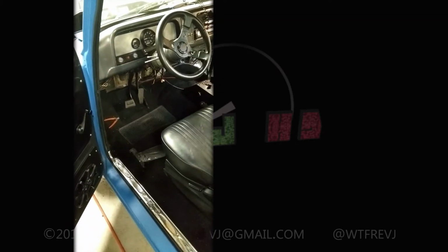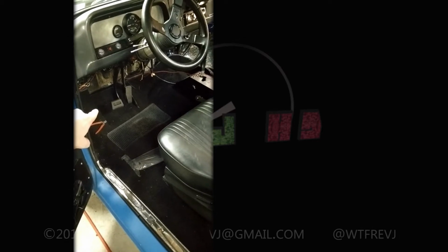But I love this truck, and we decided that if we could lay the floor down a few inches and move the pedals over, we could get a lot more ergonomic driving position. And if I open the door here, you can see what I mean. So there isn't a ton of light here, and it's going to look a little grainy. But as you guys can see here, there is a section of the floor that has actually been laid down nearly 5.5 inches at the top.